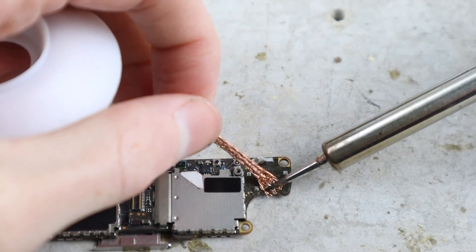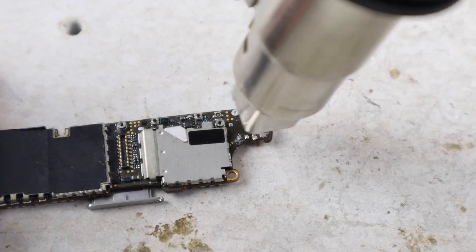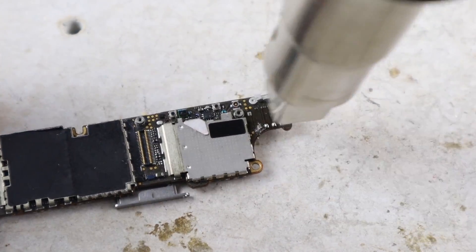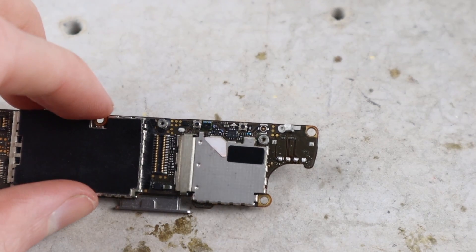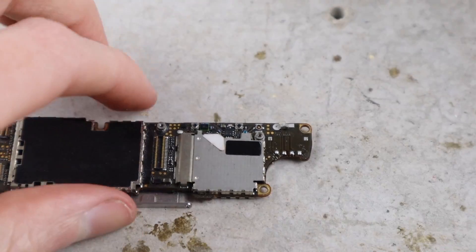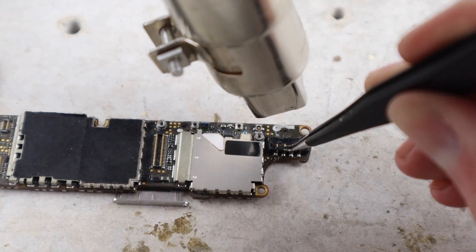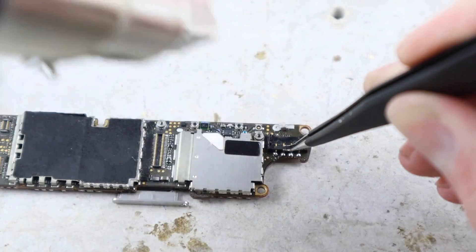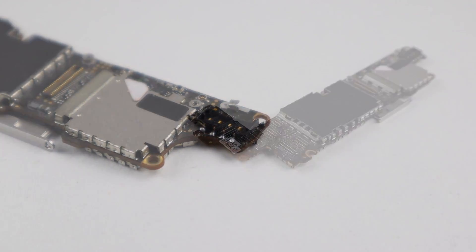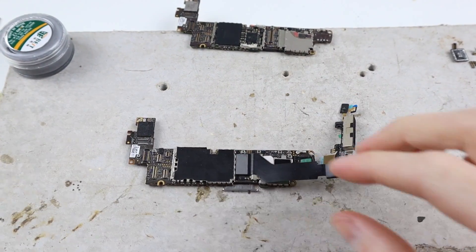In my first attempt I used a soldering iron, which isn't a good idea. In this video I'm doing the repair with a hot air station which works much better. I'm new at this so it won't be perfect, but as long as I get the phone functioning that's all I'm after. With some new solder paste applied to the pads — basically a paste form of solder that melts when heated — I held the salvaged battery connector in place with tweezers and used the hot air rework station to solder it in. Looking at the connection I probably added a bit too much solder, but as long as it works I'm not too concerned.